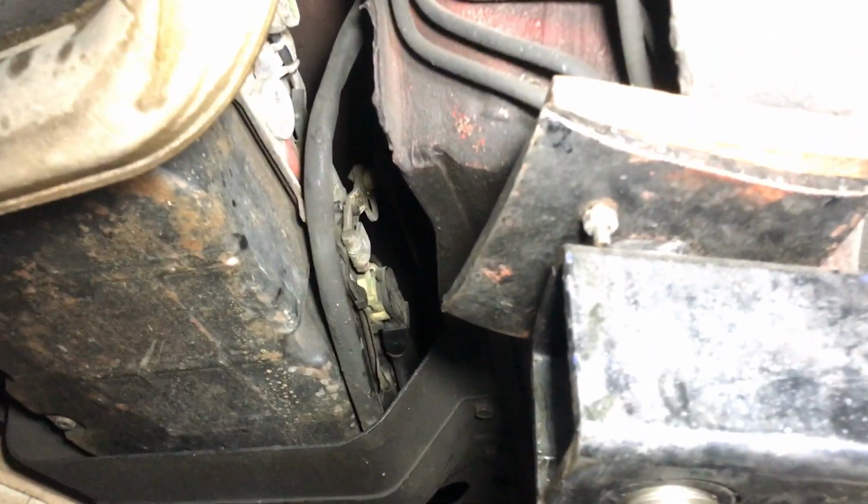The front bushing is on the shift lever on the left side of the transmission. And I'm looking at the shift rod there. Looks like the bushing has popped out. Let's take a closer look at that one. See that the bushing's broken in half. And once again, that's rattling. So when you have both bushings gone, that's what I consider a dangerous situation on these cars.